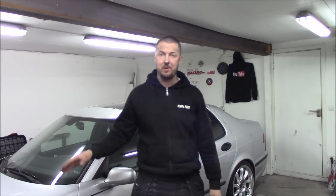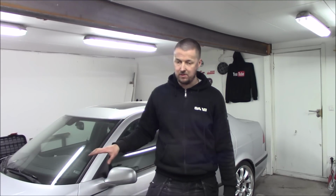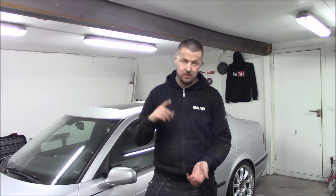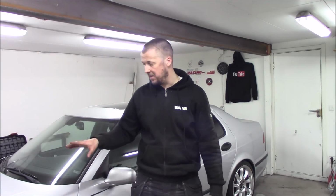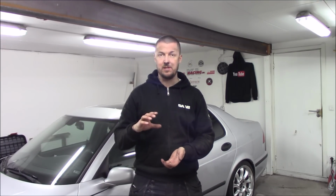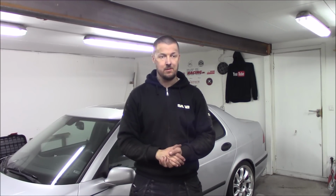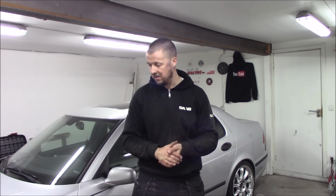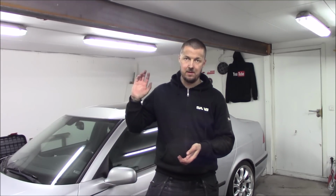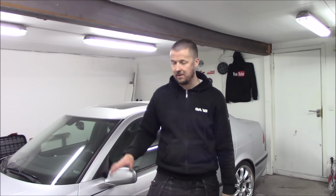So I'm really happy about how this turned out. Of course the car is going to be in the garage for a while now, because we are going to do the gearbox and everything else, build the exhaust. So I will definitely make the car higher before I go drive it, because the springs and the dampeners will settle a little bit on the first drive for a couple of miles. Some say the first 100 miles or something like that, but we will raise it a bit and drive it and then lower it to the exact height that we want.